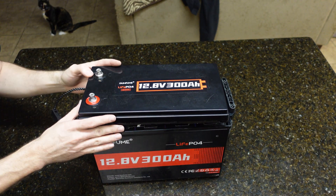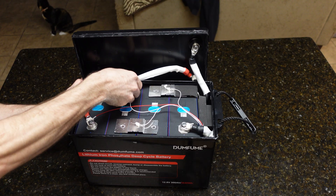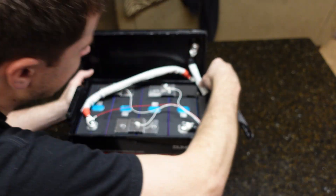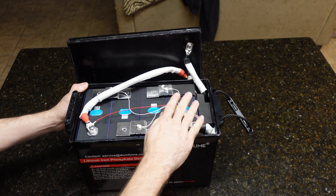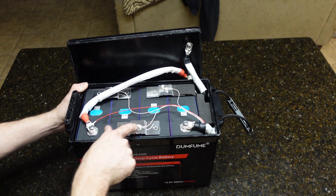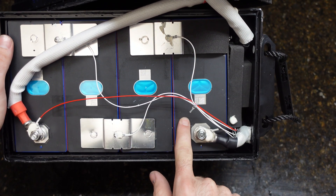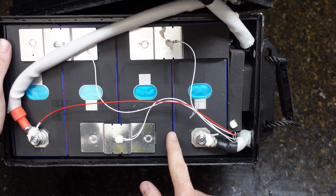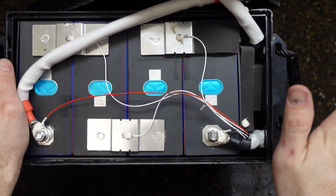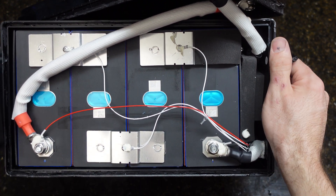We pried the cover off the battery to take a look inside. There's a nice thick conductor for the positive — feels like four or two gauge wire — and three what look like eight gauge wires for the negative. The balance harness is kind of floating. The cells are quite large and have laser welds. However, I noticed a gap between cells, which tells me one cell may be swelling and pushing the others apart — that's a concern.